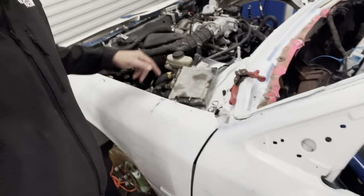I don't think we're racing, so I need to go to the junkyard and get a new PCM. I think that's kind of boiling down to our pinpoint spot for air. I was welding on the car with the battery in it, but I didn't have the negative terminal connected. And on the power terminal, we had the master shutoff switch. It should have been fine, but welding on this car with the harness that's all chopped up and just exposed wires touching the roll bar, you never know. I think we probably fried something, and it's all kind of pinpointing to this box right here.